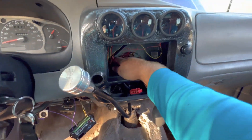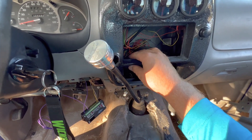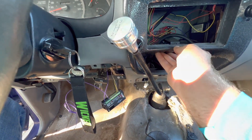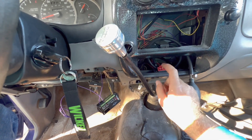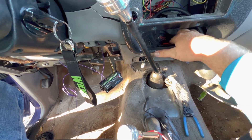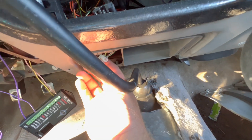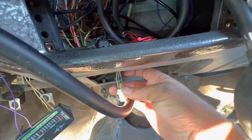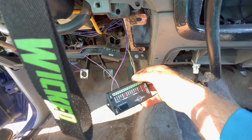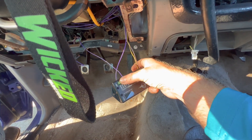Inside this cluster of wires I can see the purple with white is the hot wire for switched power, and green and yellow is the ground. So we've got purple-white for switched power, green and yellow for ground, purple in for the diesel input, and purple out for the normal tach output. I also need a new clip since one is broken.